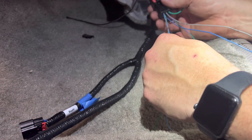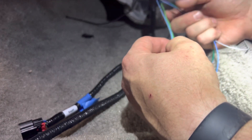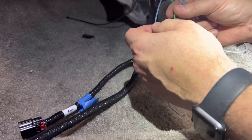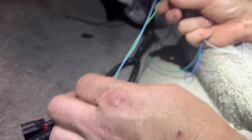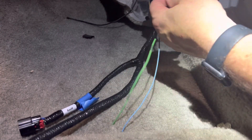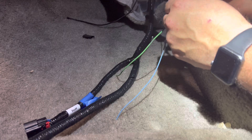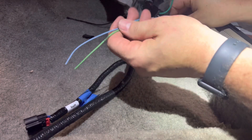Now back to this 168 connector. You're going to grab the wire labeled toggle and SMR — that's starter motor request — and this one is for turning on the ECU. These here are for your upshift and downshift. I'm just going to tie them off for now so I know I'm not messing with those.